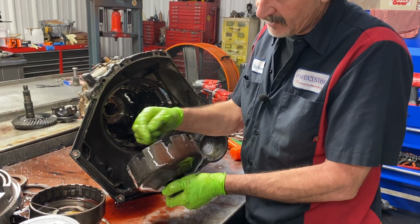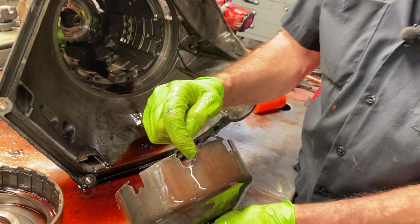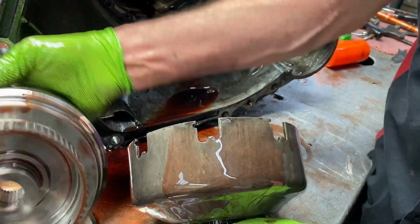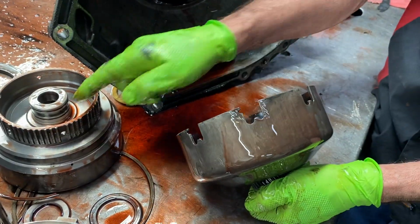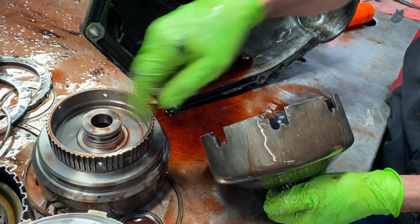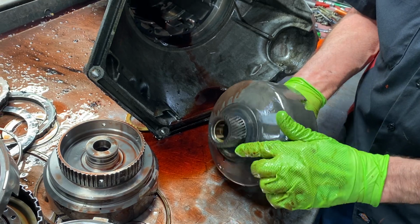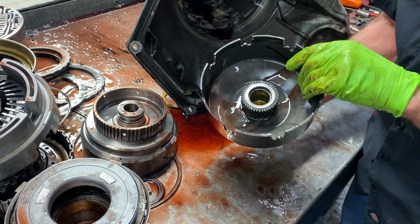So now the shell has changed in different ways right through here. When I was telling you they did away with that bearing in the forward drum, down through here, they changed it up here to keep it lifted off when they got rid of the washer. I mean, they did all kinds of crazy stuff. Same way here, you want to look at both sides of these gears because you've got a drive side and a coast side on both sides.